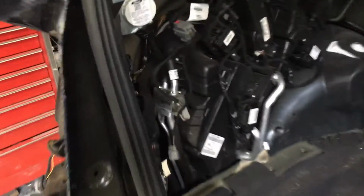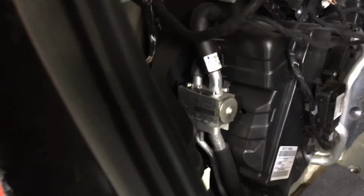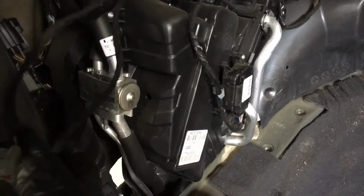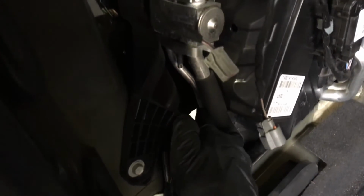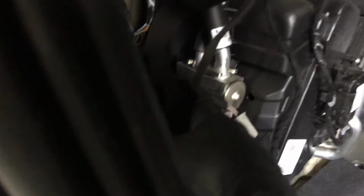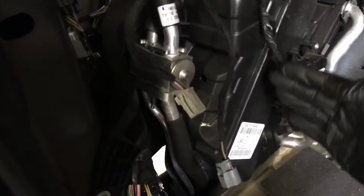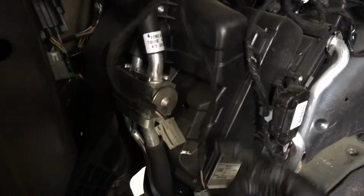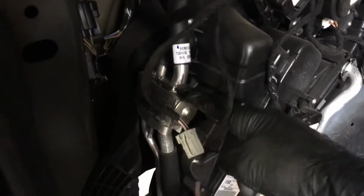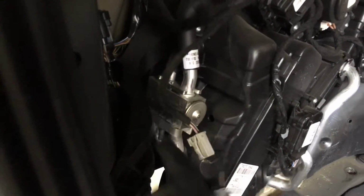setup here. Here you can more clearly see the expansion valve. You have the liquid line coming in right here. The small line, see that small little line right there? It goes through the expansion valve and it goes into a slightly larger line right there. Goes through the evaporator, and the evaporator is kind of like in this order right here. Goes through the evaporator and returns in the larger suction line going through the expansion valve.